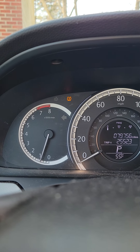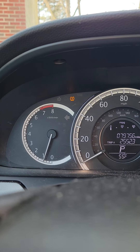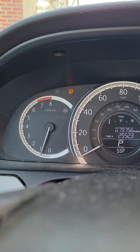But you don't want to go to the full amount that's written on the tire. So again, if it says 51 PSI, you can get away easily by putting 45 PSI in all four tires. I hope this video helps, guys. Thanks for watching and take care.